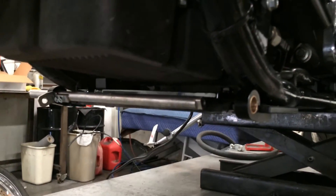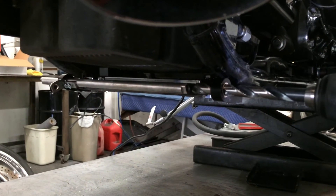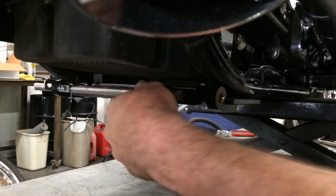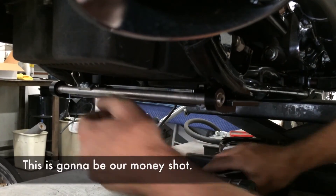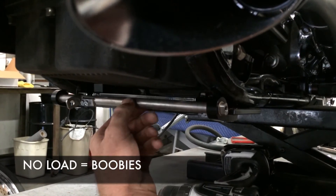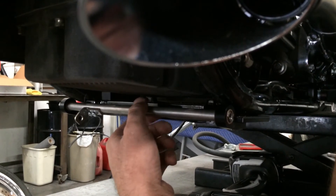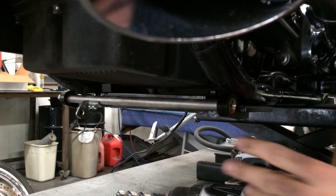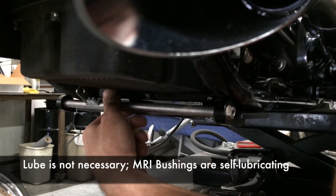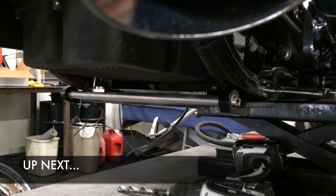This ought to be probably the last go around. We're going to keep working this down and in, then recheck fit — and this is going to be our money shot right there. As you can see, this is just great. There's no load on that. It's a strong actuator but you can lock this shaft up, so I'm really glad this happened today. The only other thing we'd want to do is blow these off. You do not need to put lube on them — lube is generated from the bushing through usage. So I'm going to switch back over, get the pivot hooked up, and continue on.